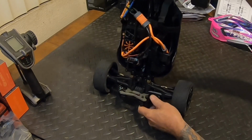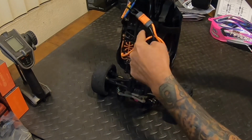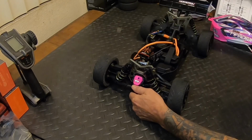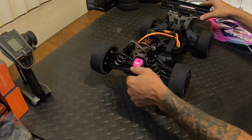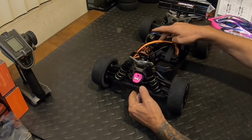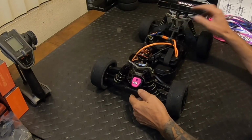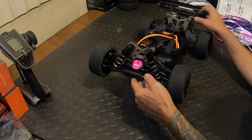When you're like this, you want as much drive as you can to the front wheels. And that's putting a thick fluid here. Same thing when you're dead stop and you nail that trigger to full throttle, this starts to come up. If the fluid is too thick here, it's going to just want a wheelie. If it's too thin, it's not going to raise the wheels at all.